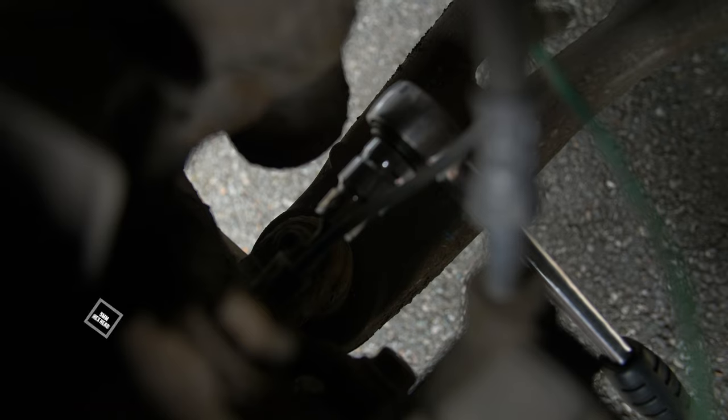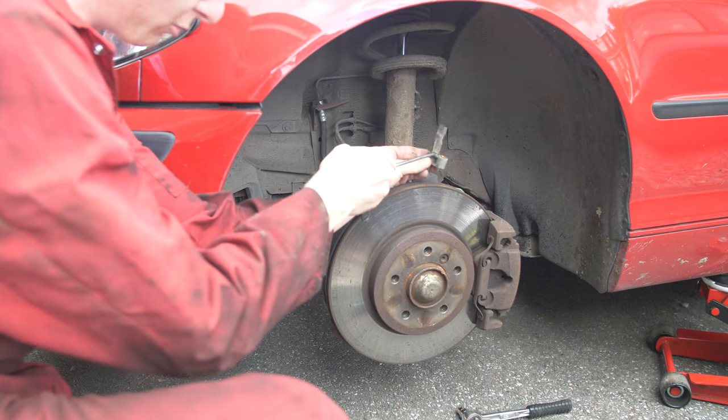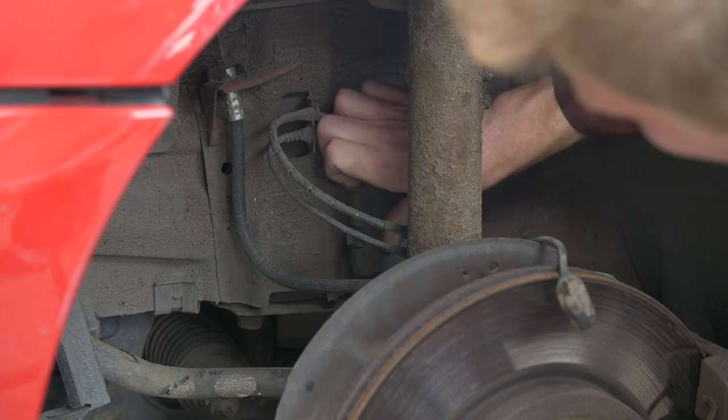You see there, just where that socket's plugged in, there's a little bolt that goes into the sensor. That's what needs taking out. Bolt goes through here, you need to pry it out. Comes to this little box here. So you just pinch the bottom, yank it out.